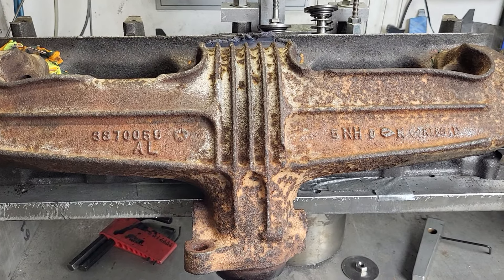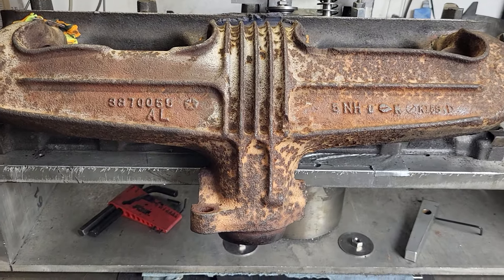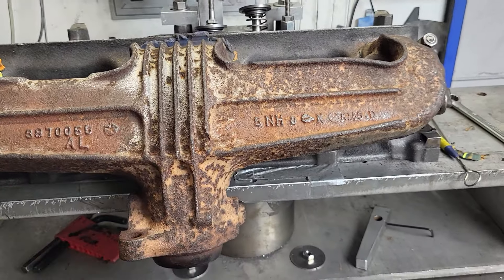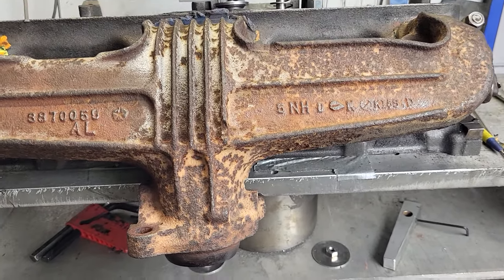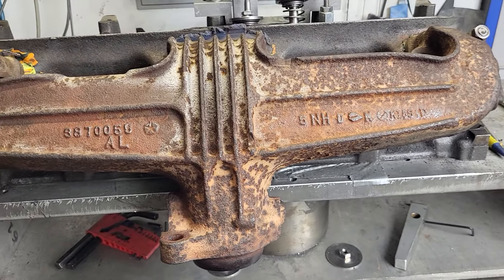It's strange that I had to do it twice, but this is on the Mission Impossible head. I had to turn it around on the bench, I had to grind the bore adapter just to get it close — it's not perfect. I wound up having a gasket made of clay because I don't have any exhaust gaskets that would seal it.